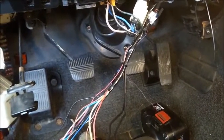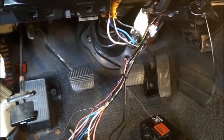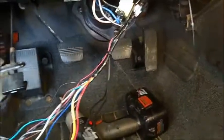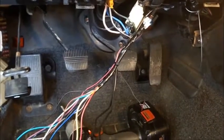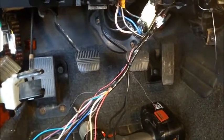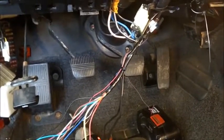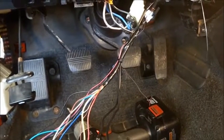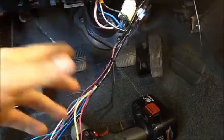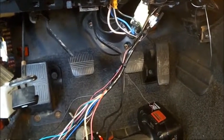Some guys like to hook the starter kill up to a fuel pump or the ignition wire in the harness as well. This car is manual, so even with the starter kill they'd be able to push-start it. So I may end up doing the ignition cut instead. My area's not really high for stolen cars — I'm doing this more for the keyless entry; the security is more of an added bonus. But it's designed as a starter kill, so if you want to go by the book, hook it up to that. You can also interrupt your fuel pump wire or ignition wire so they wouldn't even be able to push-start it.